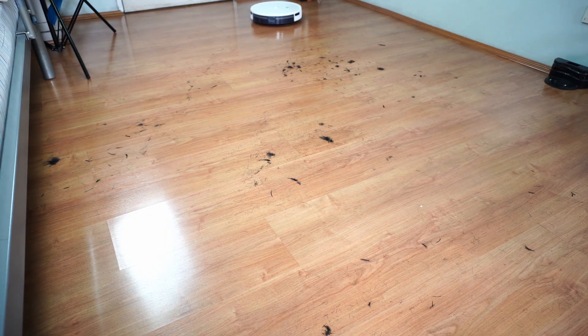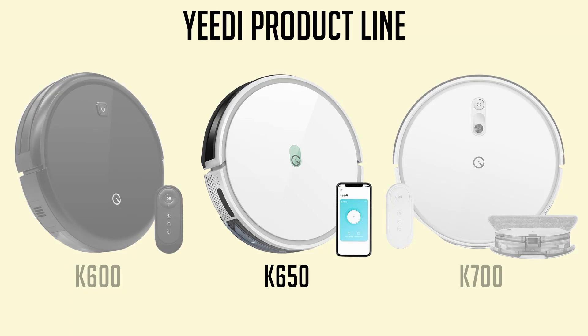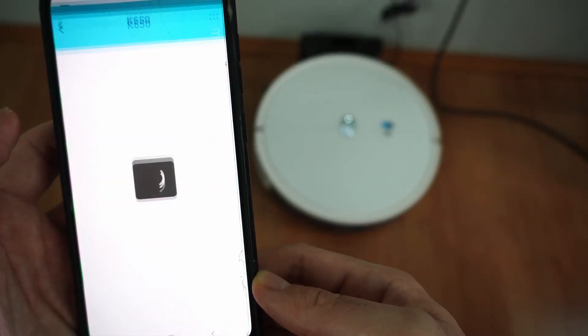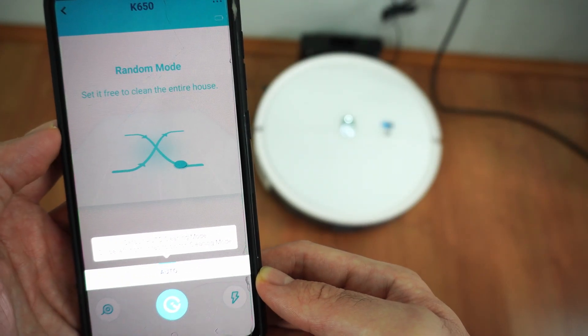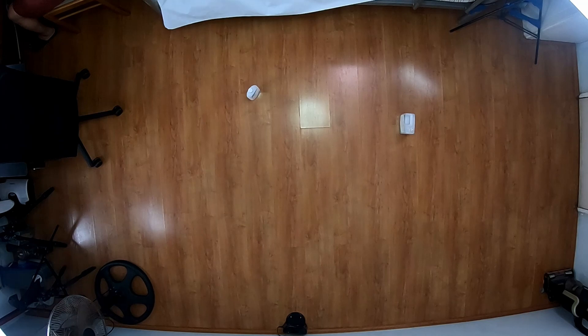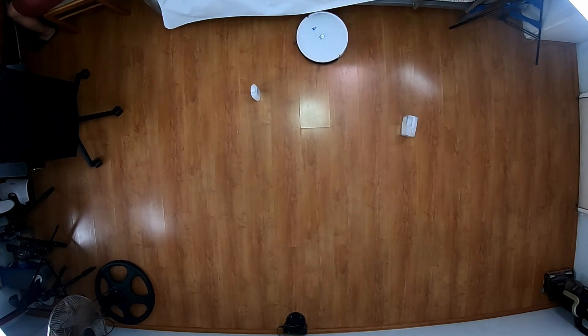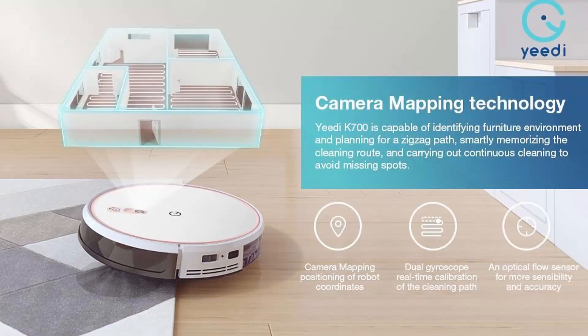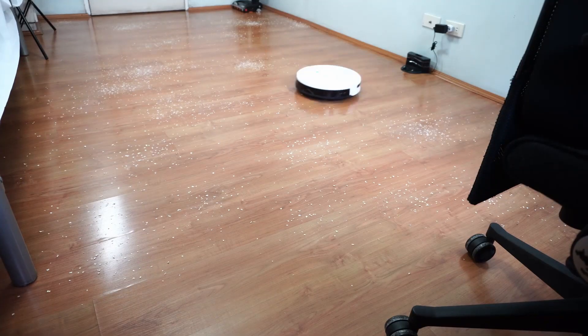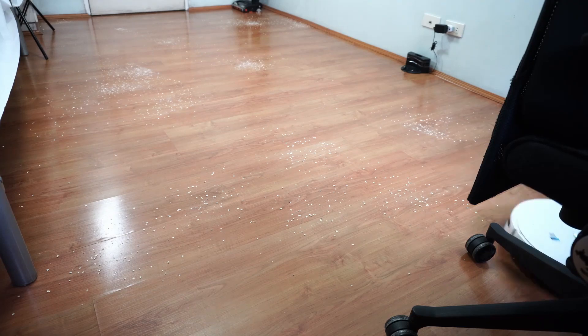First, let's go through the features. The K650 is Yidi's middle option between the K600 and K700. This option has 2000 pascals of suction, 500 more than the entry-level K600. Another upgrade is the Wi-Fi connectivity and smartphone app, so it doesn't come with the remote since all the functionality is in the app. However, it retains the random navigation of the K600. Only the higher-end K700 has smart navigation with a top-mounted camera sensor, dual gyroscopes, and optical flow sensor. Of the three models, only the K700 has the mopping attachment. The K650 unit I got does not have any water tank, so it only has one function.